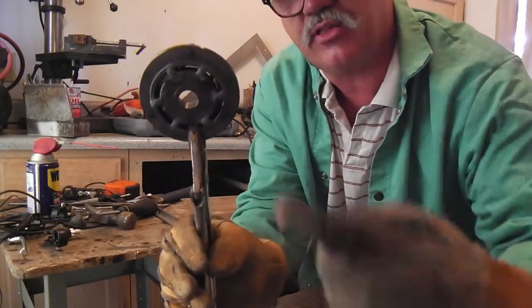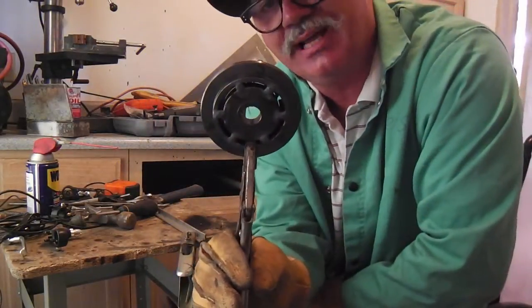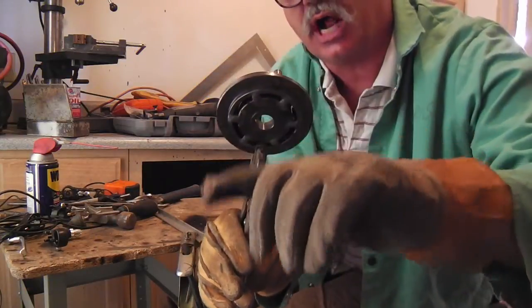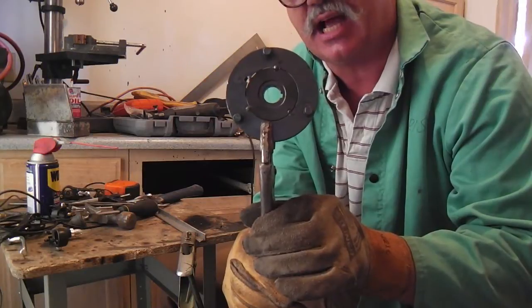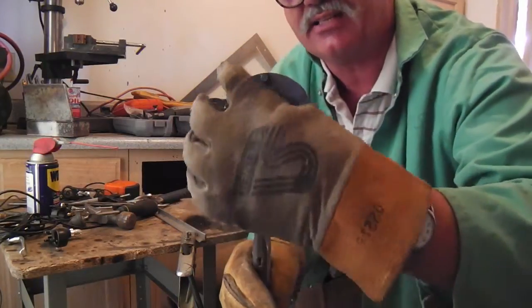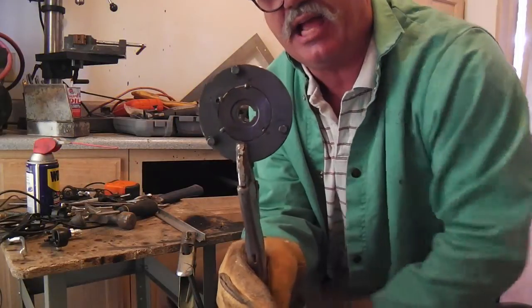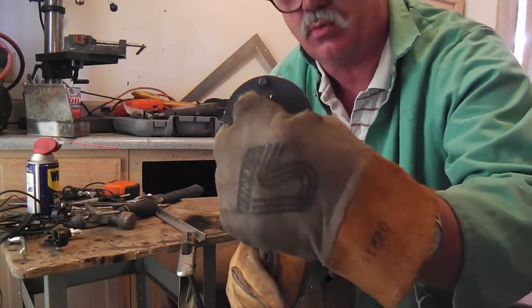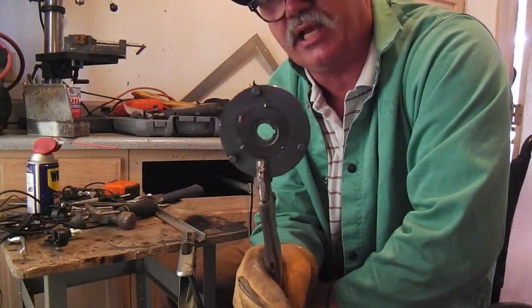Okay, here it is on this side. I've got it welded up, all those little cogs, and it's kind of looking like a mag wheel from this side, but I'll grind this flush, and then I'll flip it around and grind off that little veneer sheet that's in there, and that'll expose the channel on this side, and then I'll weld it the same way I did on the other side, and it'll be doubly strong that way.